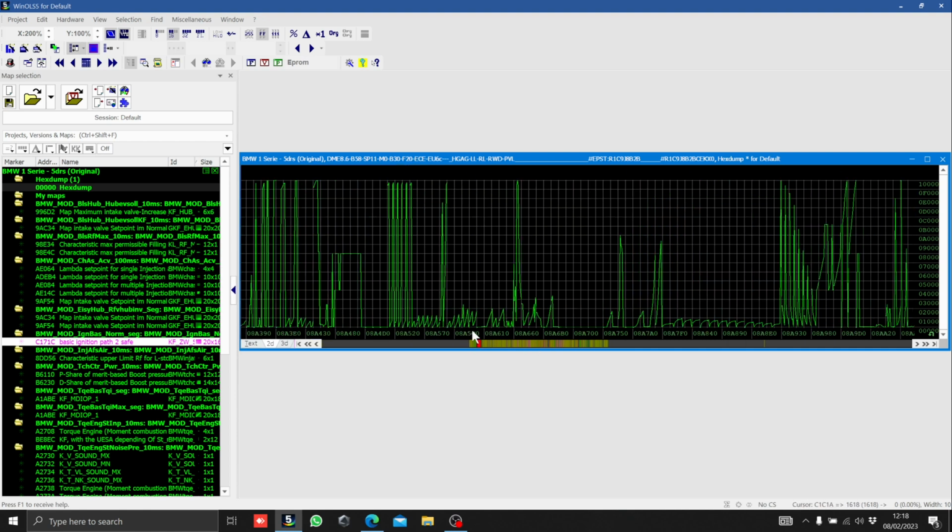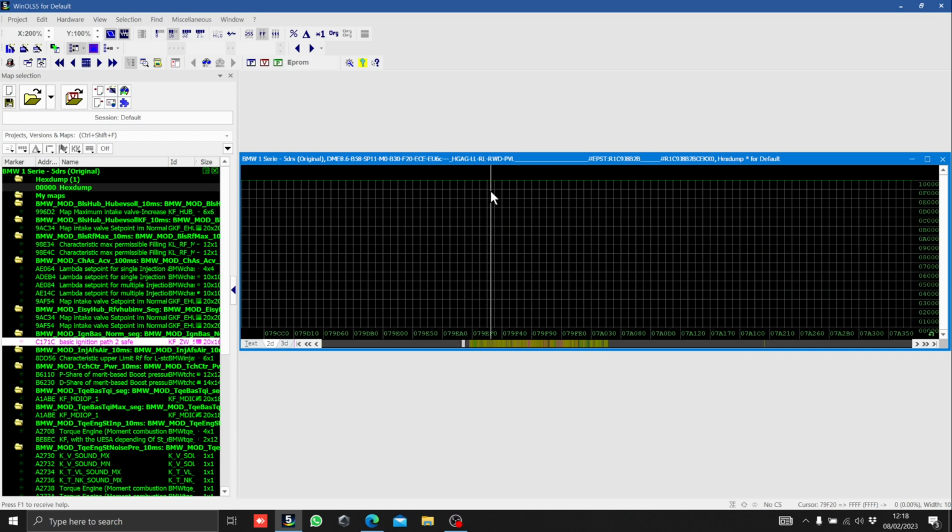So you'd probably imagine that the way this ECU works is at a given throttle or RPM, a certain amount of boost is being requested. These don't actually work off of boost, they work off of load and torque. So there are some boost maps, but they're mainly like boost limiters, and it's the load and torque that you actually got to focus on. So load is a calculation of things like ignition timing, lambda, VANOS, boost and throttle, and using all of those systems together, which all affect power, you can come up with a load target.